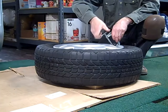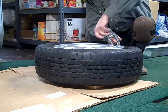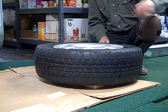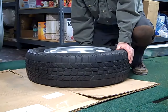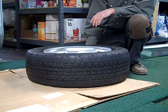It's just that easy if you know the trick. The trick is understanding the design of the wheel and the recess, and having something to hold it so it doesn't walk around on you. That's it — nothing to it. You can save yourself quite a bit of money mounting your own snow tires. I also picked up a cheap bubble balancer so I'm going to balance my own wheels too, and I'll have a set of snow tires already mounted on wheels for this fall for my Toyota.